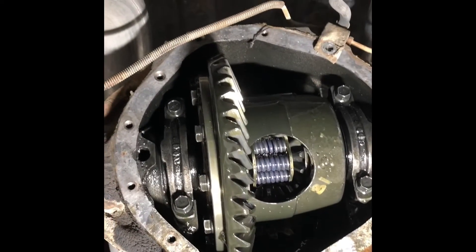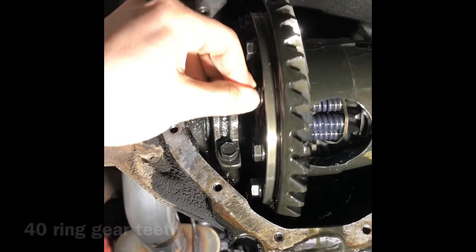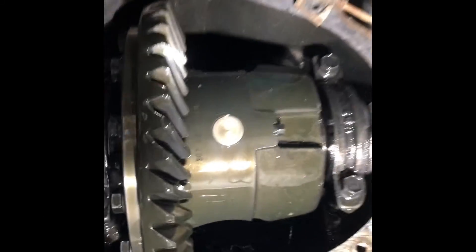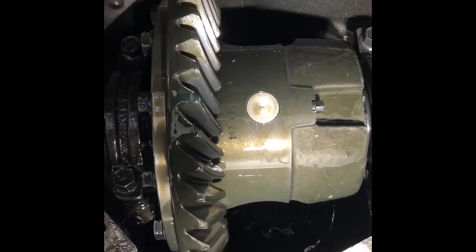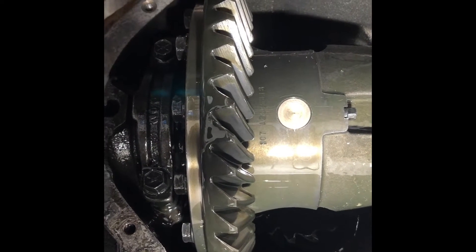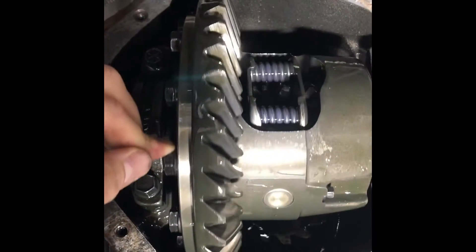In terms of performance — I don't know how I didn't realize this. If you count the number of ring gear teeth as you spin it, and then count the number of pinion teeth on your pinion, and you divide your ring gear teeth by your pinion gear teeth, you'll get your rear end ratio. And this is a 3.07, which is pretty sweet. I thought it was peppy with a 3.07 — it just needs lower gears. This thing's going to rip. I'm excited. Here's the limited slip.